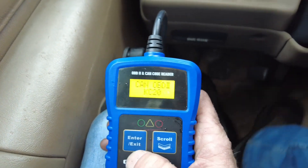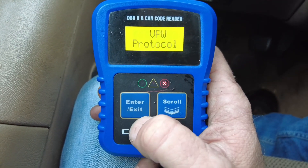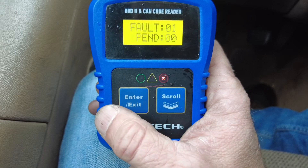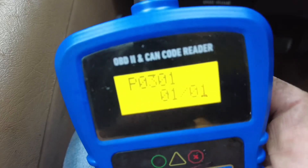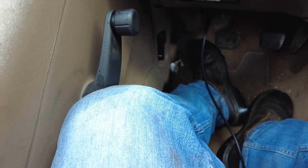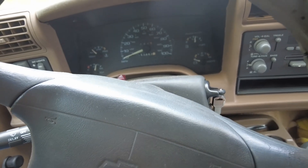Dang it, I really thought that was going to be it. One fault - P0301. Still there. We have good compression, we have new plugs, we have new wires, we have new coils, and I still got the stinking P0301. Didn't fix it. Dead gummit. All right, well, if you need a new ignition control module, I hope I helped - thank you very much.